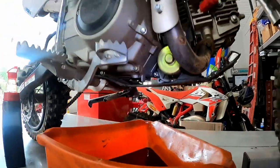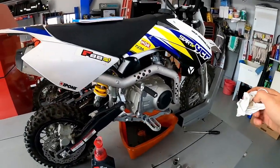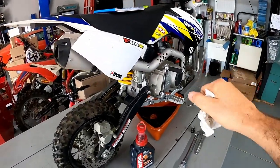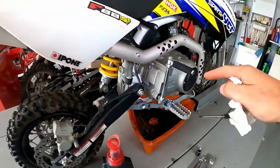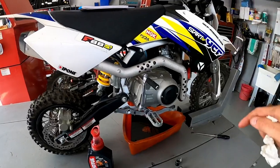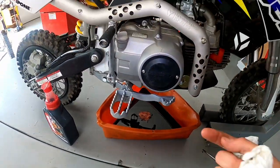It's good to mention that this bike is sitting completely flat when we do these oil changes. I will loosen the front wheel and I'm going to tip the bike from right to left a few times just to make sure that all the engine oil that could be in the bottom of the case — maybe in a little cavity — we're going to make sure all that oil comes out the drain plug. I'll tip it from side to side to make sure that we have all the oil collected in the drain pan before we reinsert the drain plug.